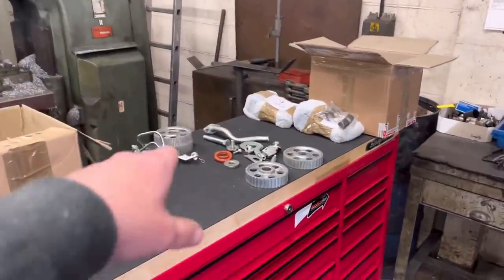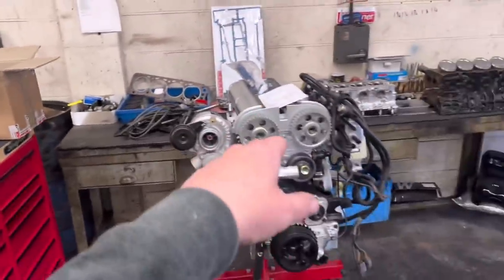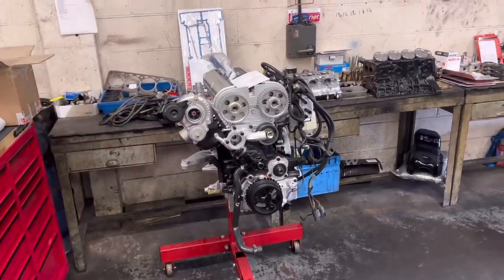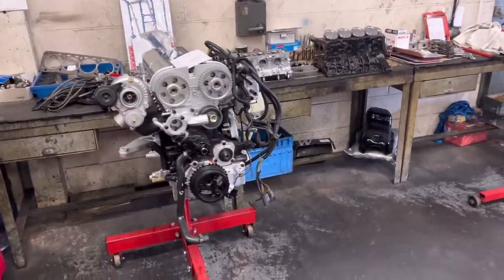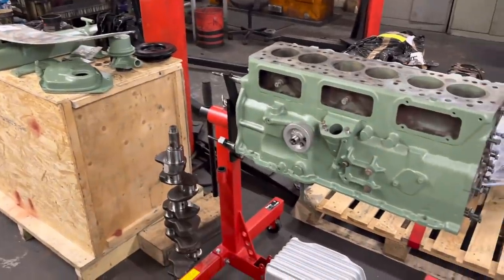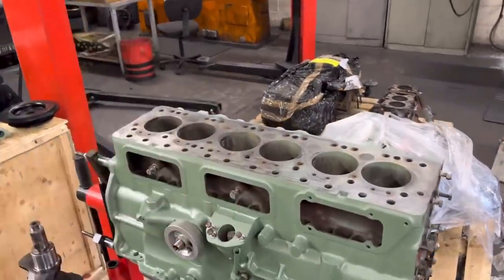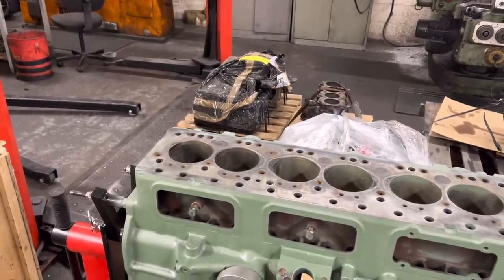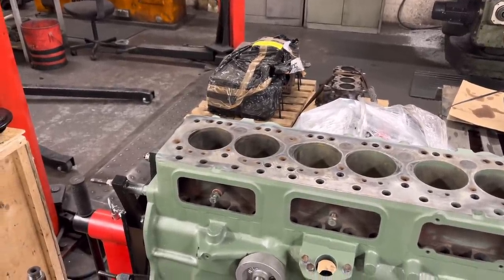Monday's job here — we've got all the plates in for this engine, so this one is going to be put back together, timed up, and then that can be on its way. The Healy engine: we've ordered all the bits for this, you can see most bits painted and what have you. I'm going to set this up Monday too. I'm going to bore it to plus 60 because that's at 40 at the minute, and then face the block, and that is all ready to go.